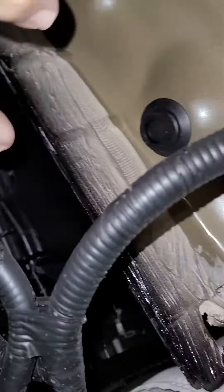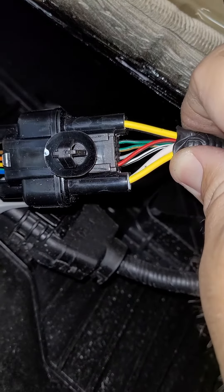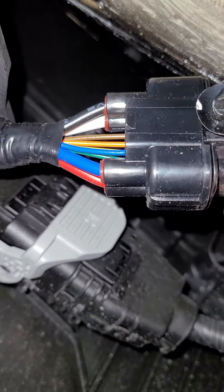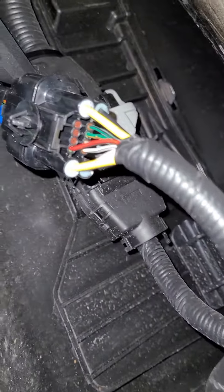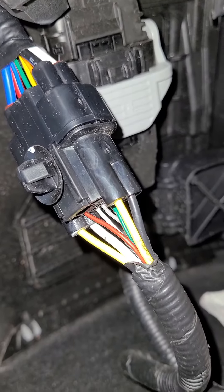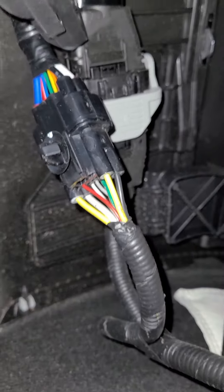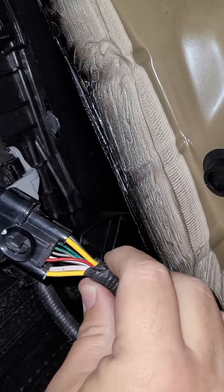Here's my issue: this is the Kia harness. These wires look like maybe 14 gauge or so at the thickest, but the wires coming out of the tow harness are at least one gauge bigger than the factory wiring harness. This is a 2021 Palisade Calligraphy, and if these are trailer wires, there's no way they're going to push 40 amps through there. For a 7-pin I thought it was rated at 40 amps, and these wires do not look like they can handle that. I may have to end up running another power wire back here — we'll see.